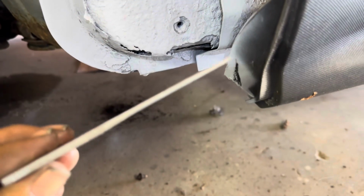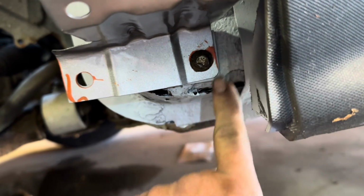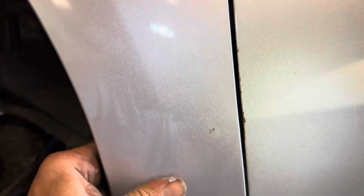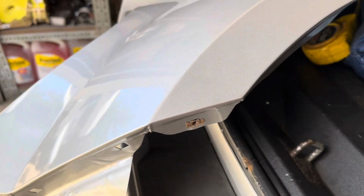Now we've taken that, thinned it down pretty well. Line all of that up again, put our bracket inside the back of there. We'll mark this out, tack weld it to this part of the body. Once we get everything kind of gapped correctly, that gap is okay. Oh, we took the fender back off, we put it in our lines. Now I'm gonna insert these things.